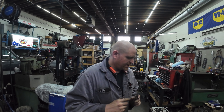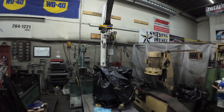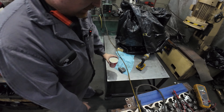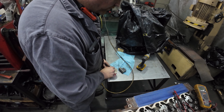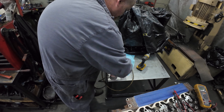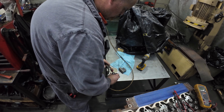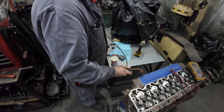The easiest way — and you don't need any tools — is to just plug it in and listen. Because I don't have coolant in this engine, I'm using a cup of water — a good old Tim Hortons cup for my Canadians — to demonstrate the noise it makes. I'm going to drop the block heater in quick so you can hear it. And funny enough, in that short period of time it actually made that cup of water warm — a good lukewarm.